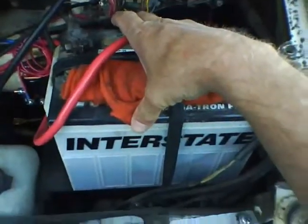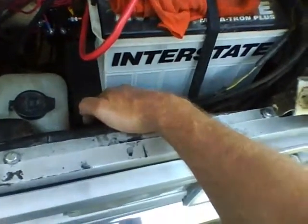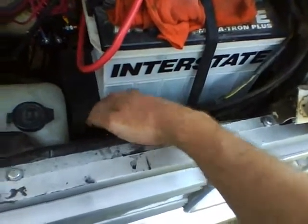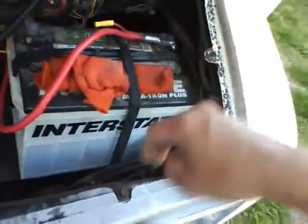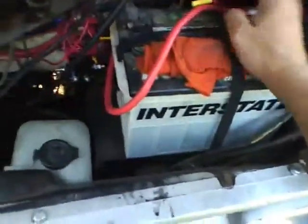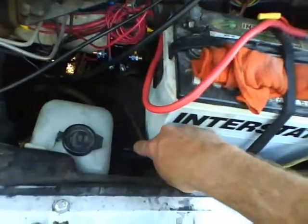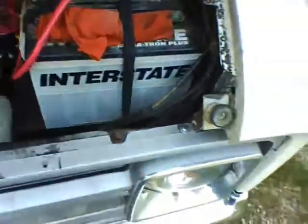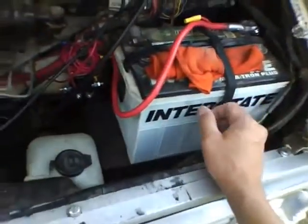After I painted this tray up — put like a couple of cans worth of Rust-Oleum on there to protect it, keep it from rusting out — I put two bolts in that bracket going that way, then I put some 90-degree bracket things on the side going into the fender, so it ain't going much anywhere. Underneath the battery, between the battery and the tray, I've got just a chunk of rubber inner tube to keep the bolt heads from punching into the bottom of the battery. For now, a bungee cord — I got to get a proper battery bracket later on this weekend.